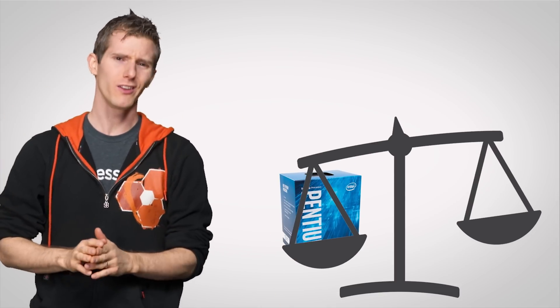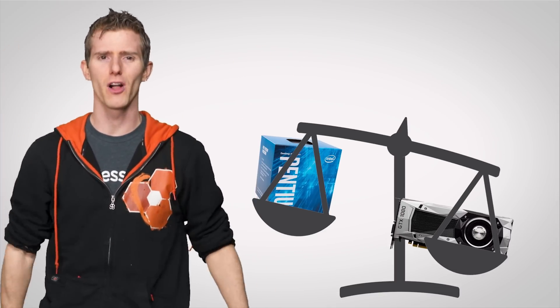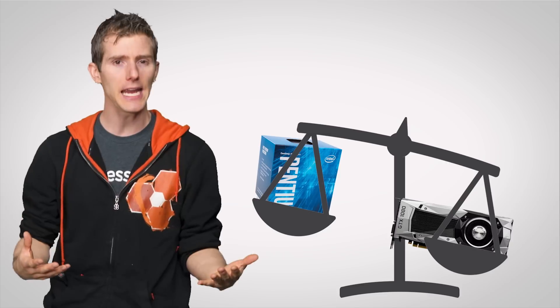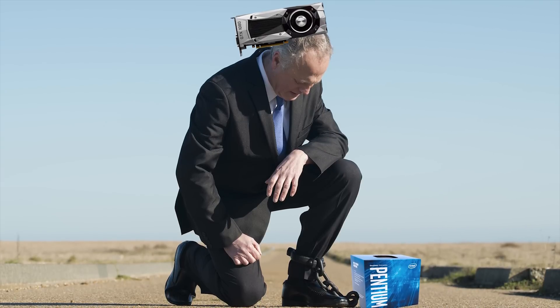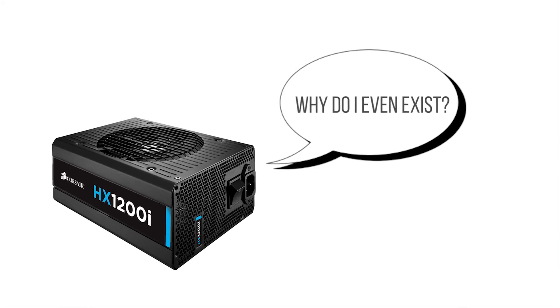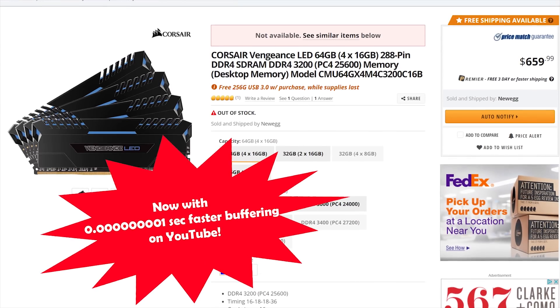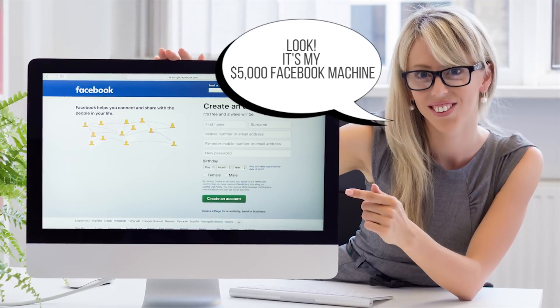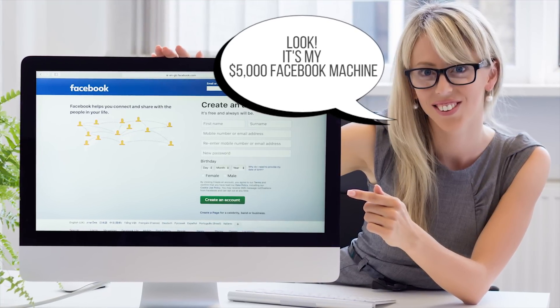For example, if you've decided to go with something like a low-end Pentium CPU, don't pair it with a six-hundred-dollar graphics card, as your underpowered processor will likely be a bottleneck in games, not allowing your graphics card to operate at peak performance. In a similar vein, buying a 1200-watt power supply for a single video card setup, or buying 64 gigs of RAM just for watching YouTube videos, are not good ideas. Think about what you want to do with your system and whether the parts you're buying make sense together before pulling the trigger.